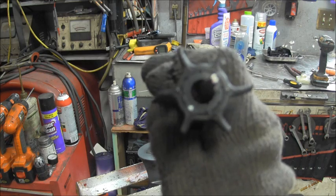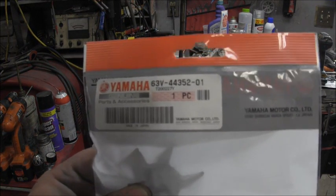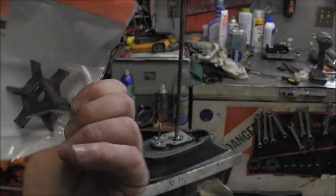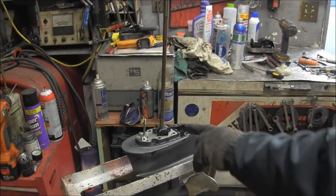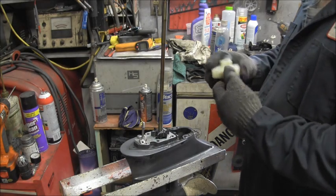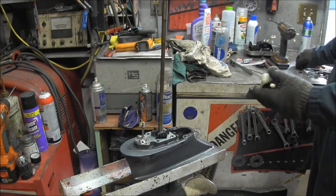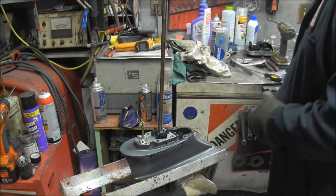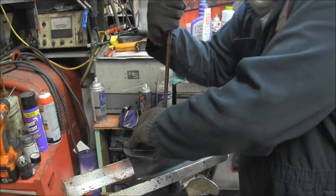Let me go look at my Yamaha stuff. I generally stock these impellers, see what I got. This is a 2011 model Yamaha 15 — there's the impeller and part number if you care. We got the new impeller. Spray some kind of lube — doesn't matter what, even soapy water is good. There's no blockage in there now, I cleaned that out. And I'm going to clean a little bit of this white powdery salt out of this water tube. Put a squirt of lube in there too. Got the key in, clockwise, down she goes.